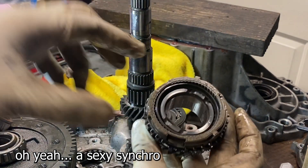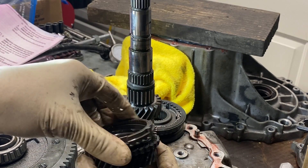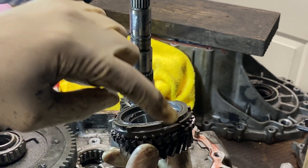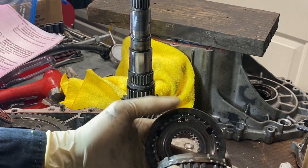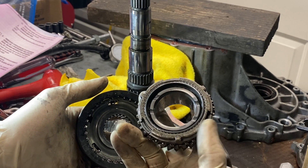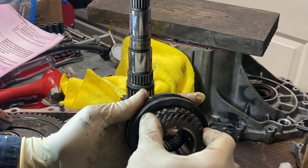We're back at the workbench and we just pressed off the third gear and the hub and the sleeve. Right underneath third gear are these two little guys - these are more needle roller bearings for third gear. That's the synchro right there - look at how it comes apart. So that faces towards the synchro. There's no direction for this guy because these guys fit into right here where the keys are - these little holes. There should be three holes right there. Those have to fit in where the shift keys are.